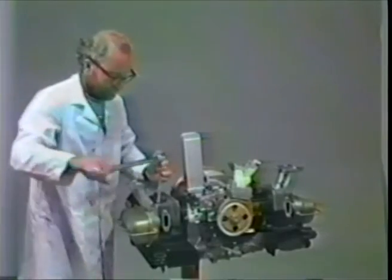Tighten down the nuts so they're snug. Get out the torque wrench. Again, 8mm nuts are torqued to between 15 and 18 foot-pounds. Zero the wrench. I like to see 17, happy medium. Torque. 2, 3, 4. Change the socket to the 14 millimeter. Sneak up on it. 1, 2. You just installed the intake manifolds.